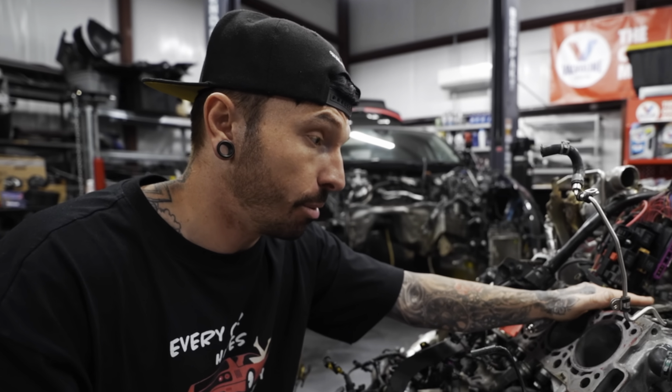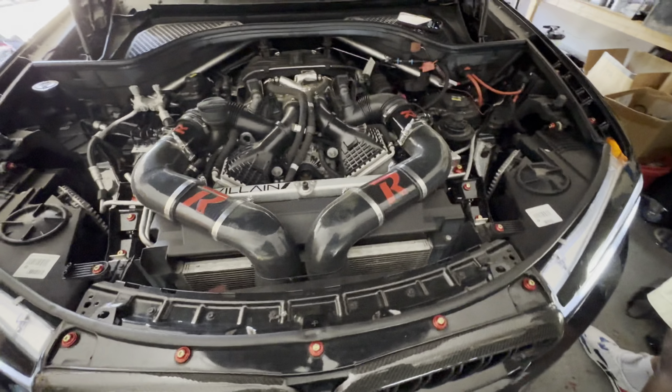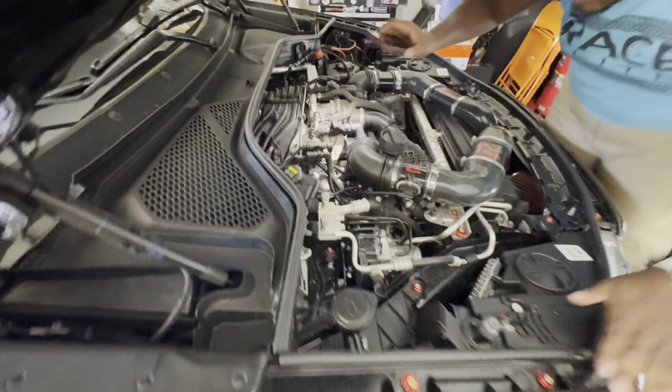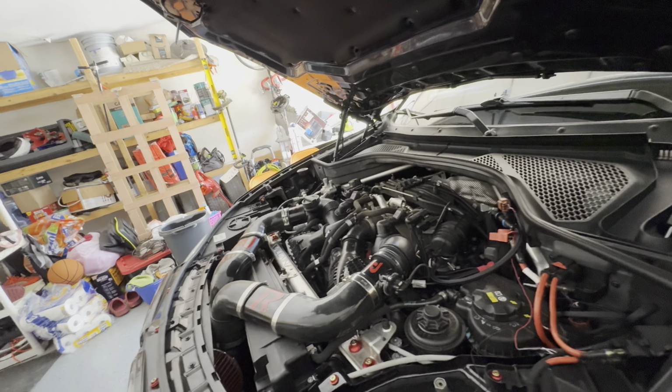So effectively, we need a new engine. After the pull at the beginning of the video, the car would go into limp mode and not come out of limp mode. Somehow, the engine was also making a very loud clanking noise. Here we go again. Got a screwdriver? We thought it was catastrophic engine failure, but we later found out it was the high pressure fuel pump.